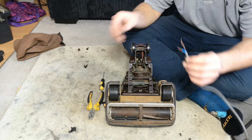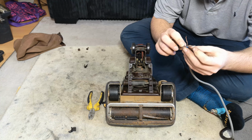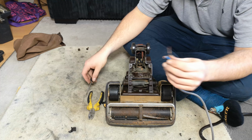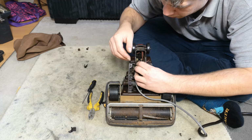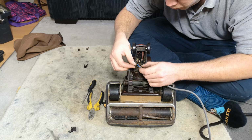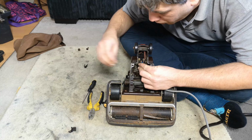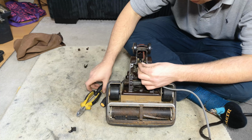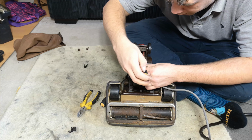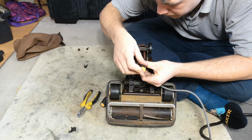So we'll take our neutral wire, and again, you probably should use crimps, but I'm a little bit on the fence, because you can get quite a neat tight little circle without using crimps, and if you then put it underneath the corresponding wire, it will clamp itself down and do quite a good job of staying in place. Let's just find the start of the thread, if I can find my screwdriver. There it is. And there is one done.